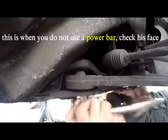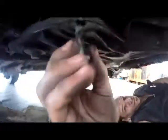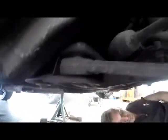Right, so now we just carry on and we loosen all bolts, and that should take our lower control arm out, ready for replacing with the new one. Alright, we'll get back to you once we've got all the bolts loose and we're ready to pull the lower control arm out. Well done, Chibi. Yeah, mate. So alright, the bolts are ready to come out. That's the back one. And then the front one, that just basically comes out. Okay, we're ready to take all the nuts off. They are so loose that you can actually do it by hand now.